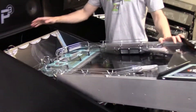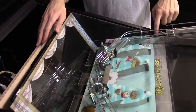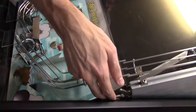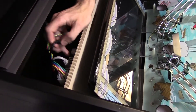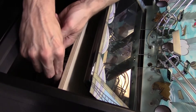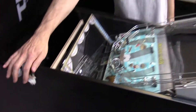Now that we're in service position, we have access to the upper playfield module. It's locked into place through these two playfield latches. I push them towards the front of the machine to unlatch them — they click into place. Then there are four connectors here on the back panel. Remove them. Sometimes these connectors have a little extra friction the first couple of times they get removed. Take the playfield harness and drape it over the machine so we have access to it later.